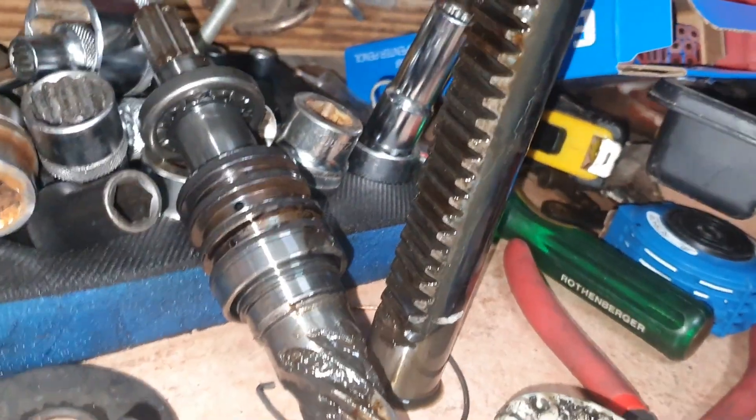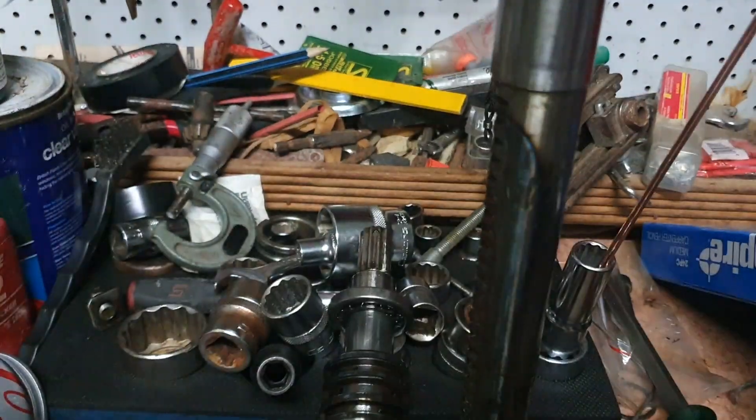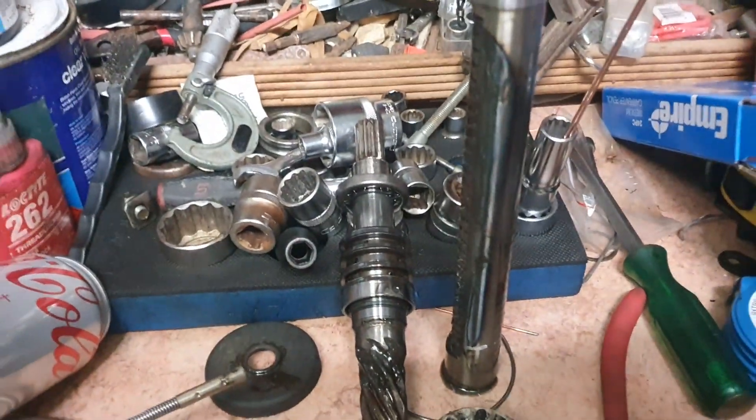So the actual steering rack itself is hard metal so the thread is okay. We only have one broken thread and that is for the sensor, which ironically didn't even need to come out of the steering rack. Now as you can see by the discoloration of the metal there — the purple rainbow color — that is from heat. So I'm assuming it got very hot there, maybe from it running out of fluid, from the system running dry with no steering fluid. Could just be a thought.